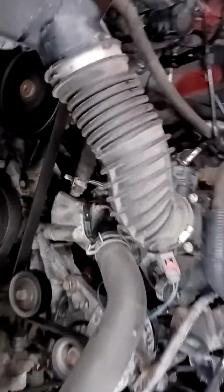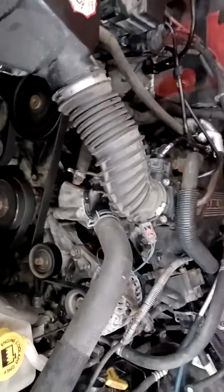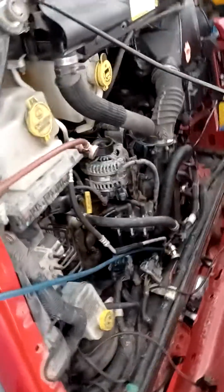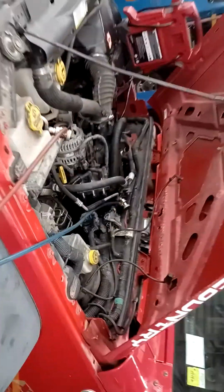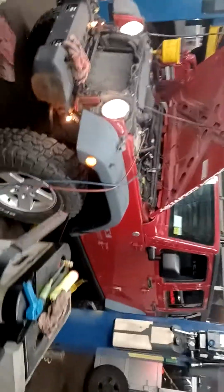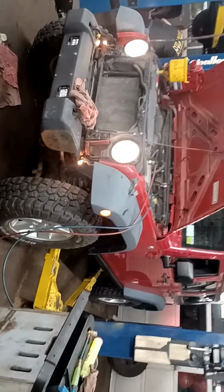So if you're looking to save some money and you have a Wrangler with a 3.8 that needs a motor, and you can't find the information online as to whether it'll fit or not, and you're not one for taking chances on buying an engine that is a gamble of working or not, going with the Caravan motor, now you know. It 100% works.